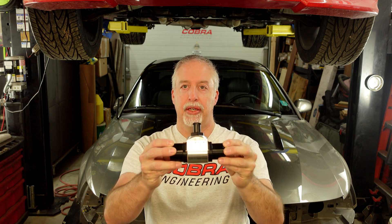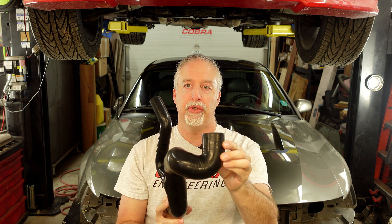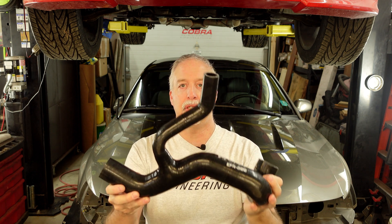Hello, James here, Cobra Engineering. We've got another Cobra Tech Talk - the long-awaited crossover delete part two, basically the lower assembly. I'm going to cover installing the T-manifold, different hose options. We're also going to talk about the improved racing hose, how it does not fit with the 03/04 alternator, but it will fit if you modify it and cut it with the reducer that I include - on the stock oil cooler it'll also fit any earlier Cobra, Mach 1, or 4-valve along those lines. Let's jump in.